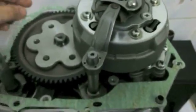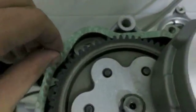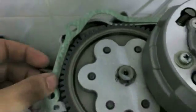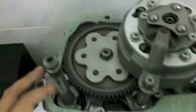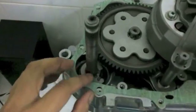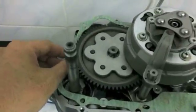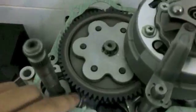When you install the gasket, the reason I like to put them on is because these maintain the gasket in its place very, very well. You can see. But let's say you have this one. It's a bit stuck in there actually. But let's say it's not in there. The gasket might sit in this one just fine. But what would happen is that it doesn't quite sit well, or worse, it can actually come off as you're trying to set the cover and land in the engine. And of course that's no good.